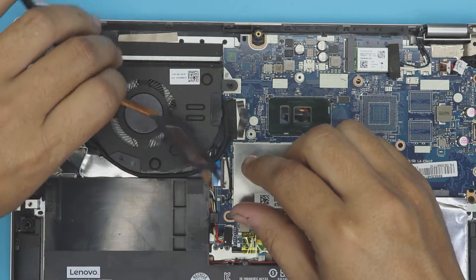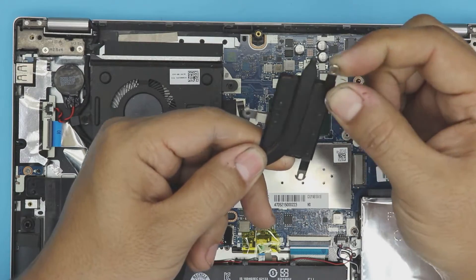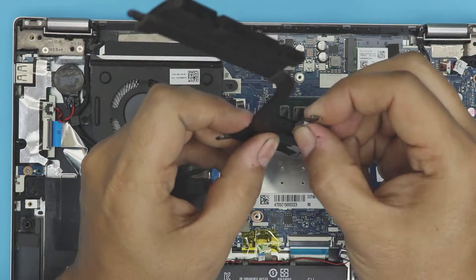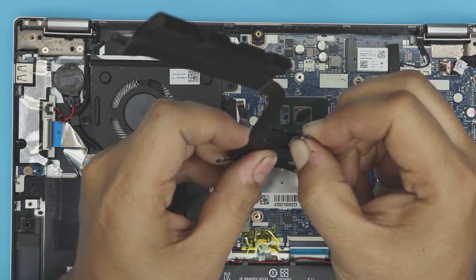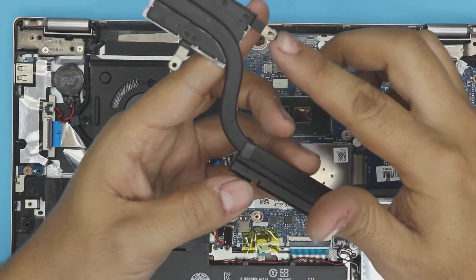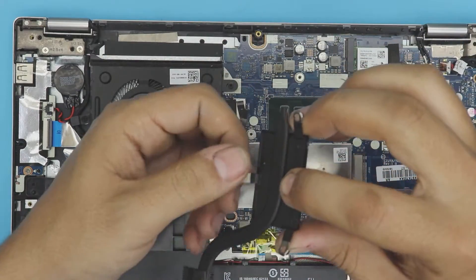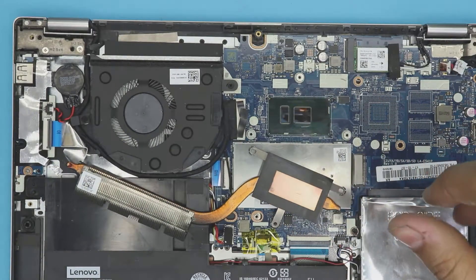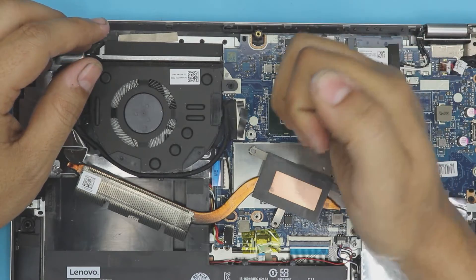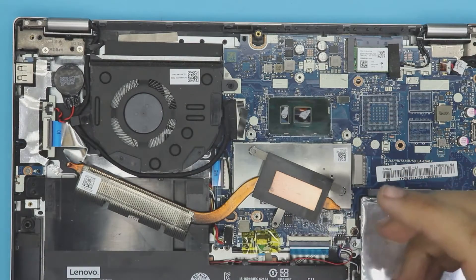What I suggest you do is bend these legs a little bit backwards to get more tension towards the CPU — it really helps out. Just a little bit; if you pay attention you can see I'm bending these ones upward slightly. Then grab your thermal paste — I'm going to use Arctic MX-4. Put one tiny drop on each CPU die.